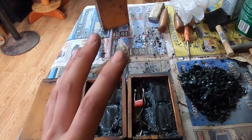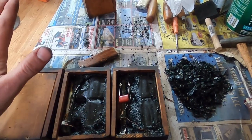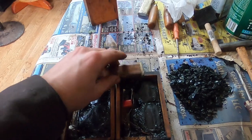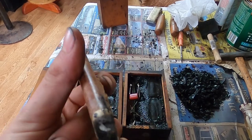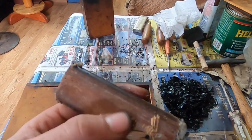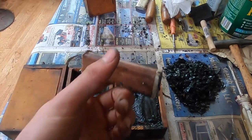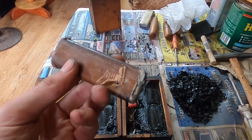They work really well and most people run original coils. You can get remade ones, but originals are in vast supply. The one thing that goes bad is the condenser or capacitor — same thing. It is basically an original capacitor. This is the one I pulled out of this coil when I put in the new one. Originally they were made with something like aluminum foil wrapped with treated paper for the dielectric in between, then rolled up. A strip is placed on each side for power — basically a rolled up parallel plate capacitor.